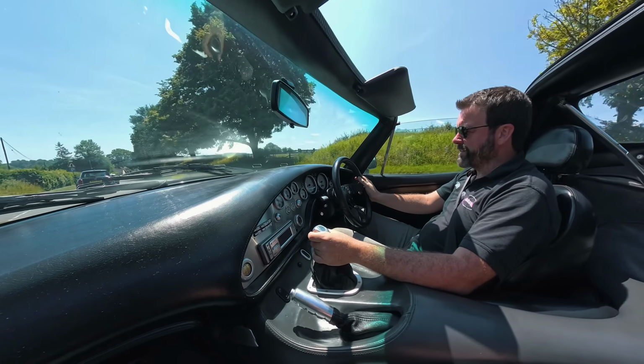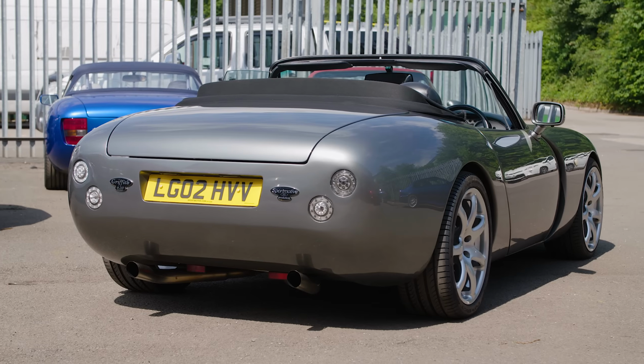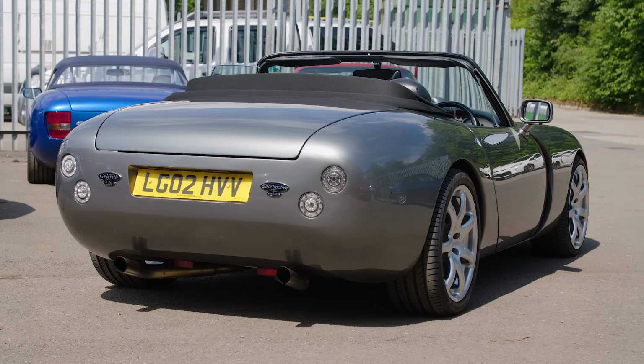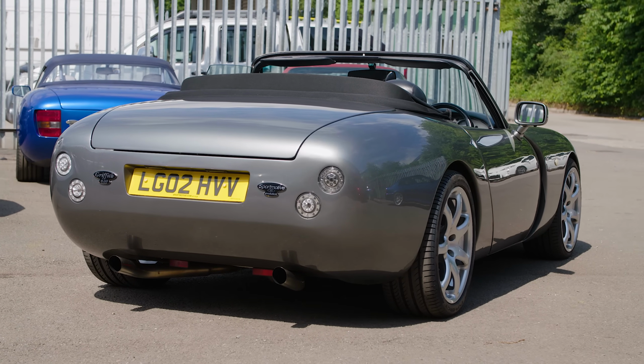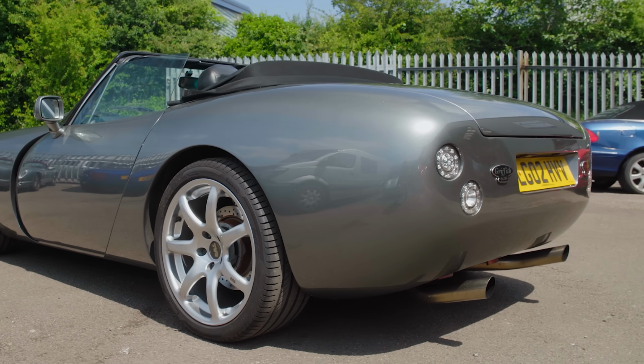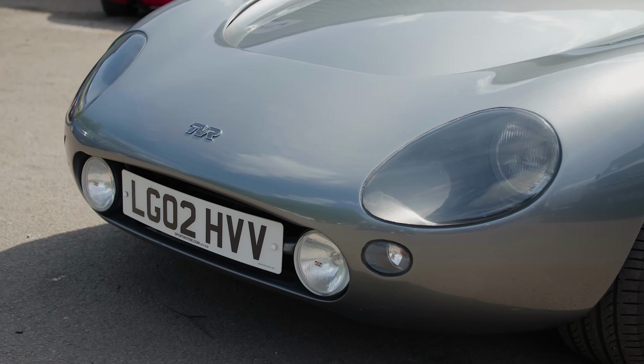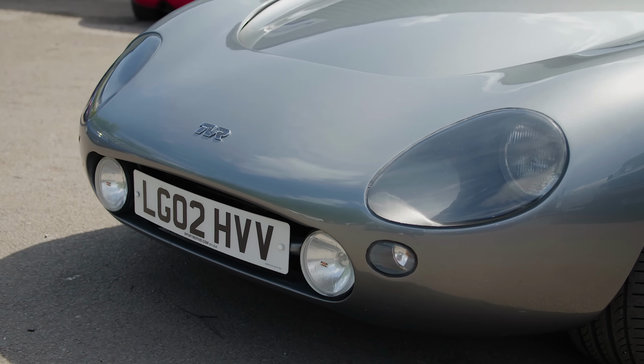Again, Frank never really liked that, so he came up with his own tail light design. He found these tail lights, and so we built pods to mount the tail lamps in, and then re-fiberglassed everything, flushed everything in, and then it had a full repaint. We faired in the front indicators as well using an Audi A4 lower fog light, believe it or not.